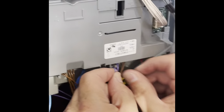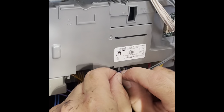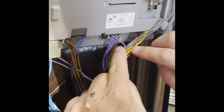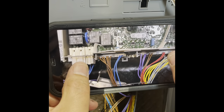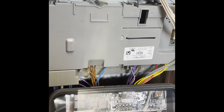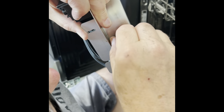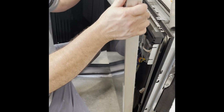So far it's working easily — don't force anything. Just straightening the wires out because I had them laid over. There's the picture I'm showing you, just to make sure all your wires match — and they did. Now open the door slightly and put the stainless steel cover back on. Put the Torx bits back in — I believe they're T20s.